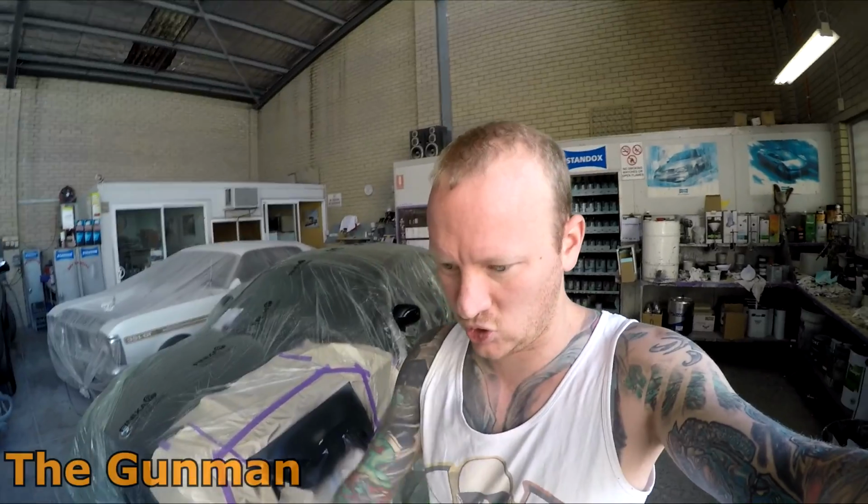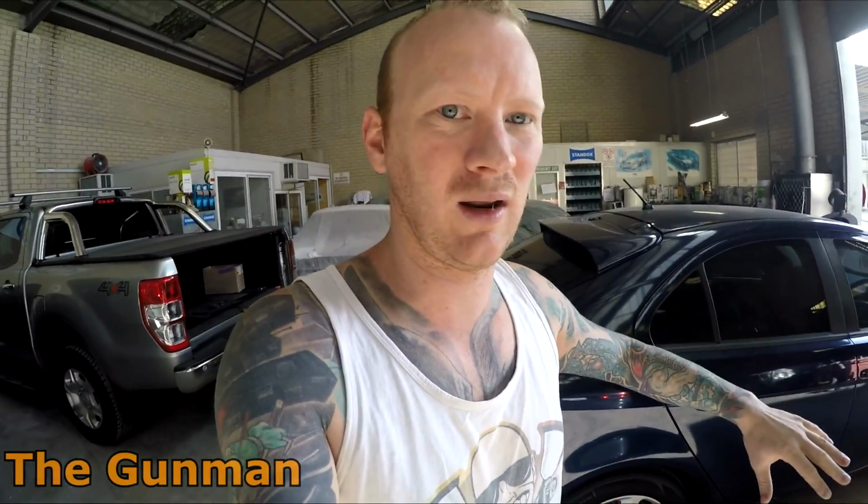So the whole way it would just go straight down, but the floor filters would clog up within a couple of weeks, and it was a really, really busy workshop, right? So you didn't always have a couple of hours or half a day. Sometimes it'd take that long to rip all those floor filters out and replace them to get the airflow going again. So you'd just be running around flat out trying to get all the jobs painted, but because you hadn't cleaned out the floor filters, it was slowing you down. Bigger picture, I should have just said, hey, stop production, that job's not getting painted, we need the floor filters changed, or else we don't continue spraying.